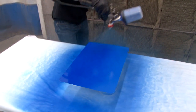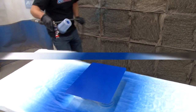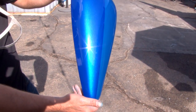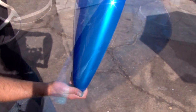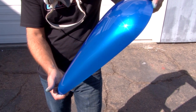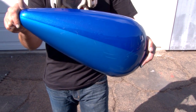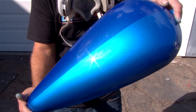We're back to put the first coat of base down, this time with a 1.2 tip. It's about 70 degrees out, so we're going to wait five to ten minutes between coats, and I'm going to put down about four coats until I'm happy with the finish. Here we have another rendition of basically the same color we just applied. One side — the lighter side — is just the sealer blue with a lot of highlight interference over it. You can really see the difference; it's way lighter than the candy pearl mix on the other side. When you turn it in the sun, it picks up that little glisten, and that's what the highlight pearl is supposed to be doing.